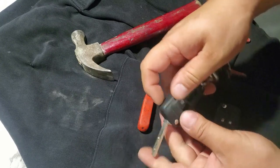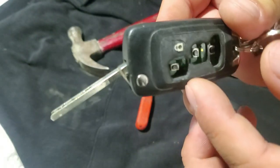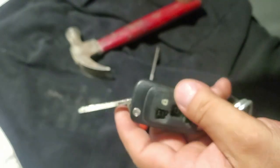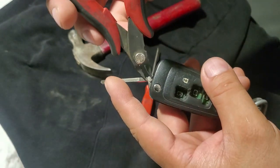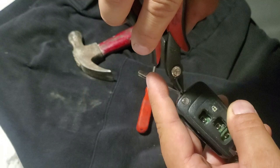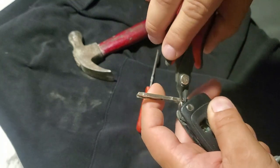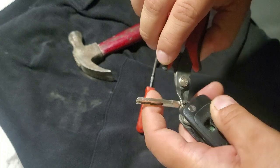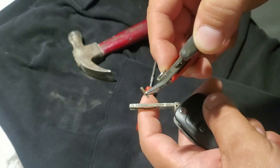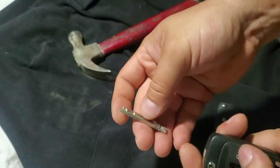I'm going to get some pretty good little hits. Okay, so now we're out — I'm going to bring it up close here. That little pin is coming out. So then we're going to get some little cutting pliers and we're just going to pull up on that little pin, working it out slowly. Walking it out — there we go. I have the pin right here, going to set that down, and then pull the key out.